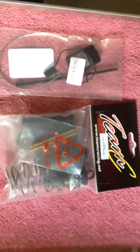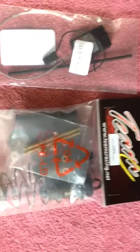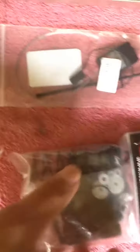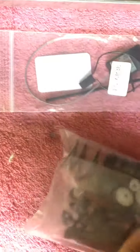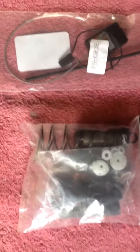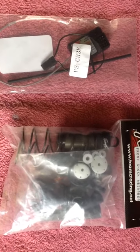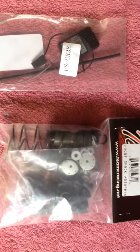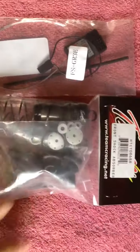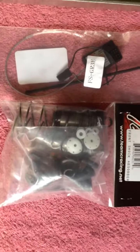The second part to come in right here — Team C front shocks. I actually today ordered the rear as well. So I'm going to change them out completely to adjustable shocks on the GTV, front and rear, just to get a better ride height on the track. I did notice it was riding a little high, and if I can get it lower with a lower center of gravity, it's going to help getting around some of those turns at the track.